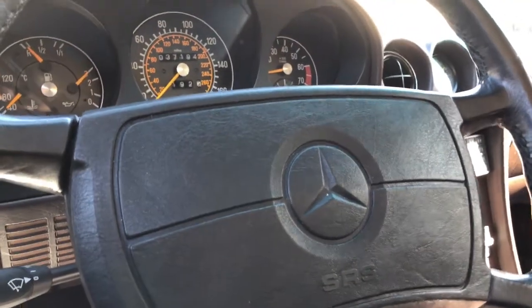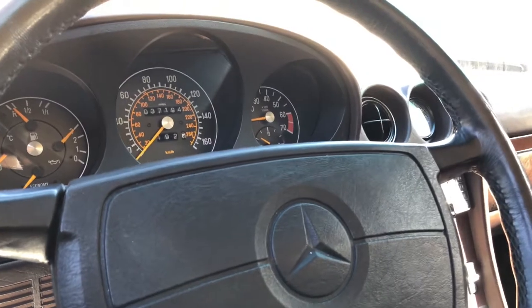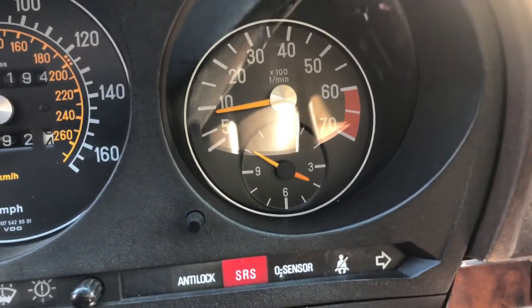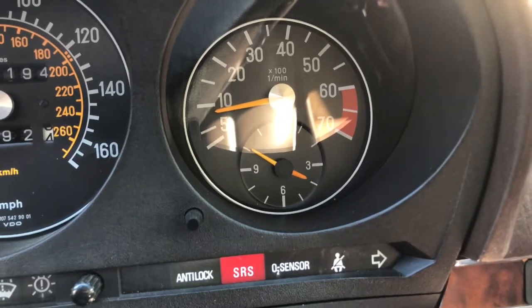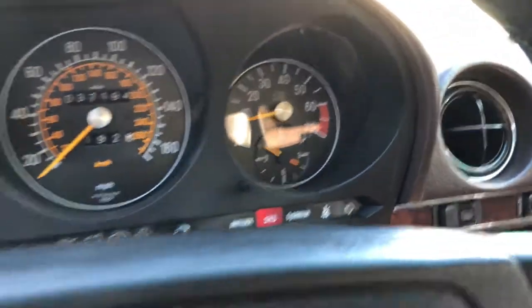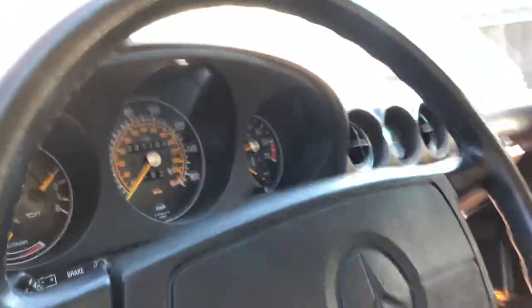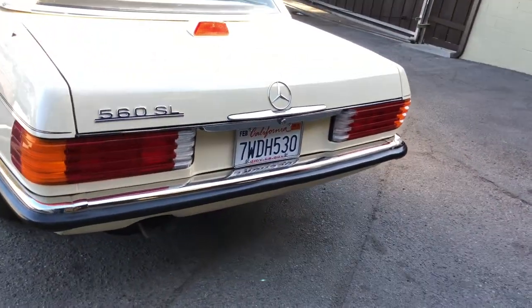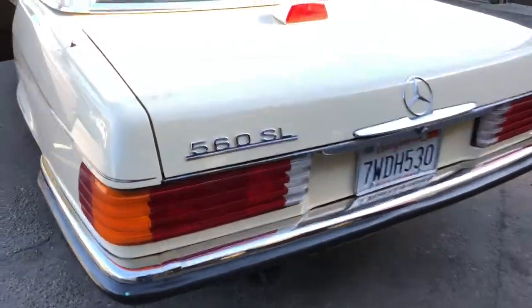to follow up on that there. Okay, just picking up a slight fluctuation of the idle right now. So we'll see what happens as it warms up a little bit. I'm gonna let it run here, even after I shut off the video, probably like for another 10, 15 minutes, while I still work on the rest of it. I took a look at the tailpipe when it first started. I didn't see no smoke coming out. So that's a good sign.